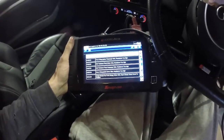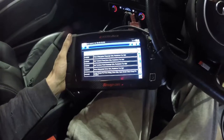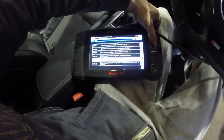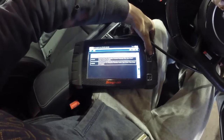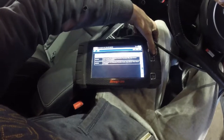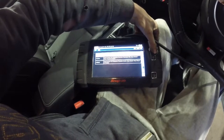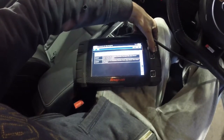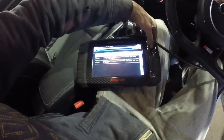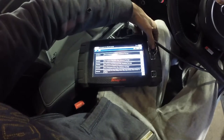The airbag I'm going to leave again until I get onto the dashboard. Crash sensor for front airbag, driver's side, open circuit — so that's going to be that wire that's been snapped at the front. Crash sensor for pedestrian protection system — there are two actuators, left and right side, with a code for each individually. Crash sensor for pedestrian protection side open circuit, and another position sensor as well. Perhaps all three will go just by changing the two actuators. So we should only be left with the knee airbag and the front airbag to the passenger side by the end of today.